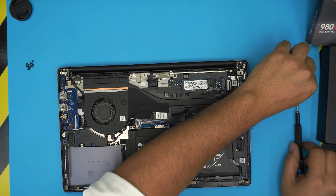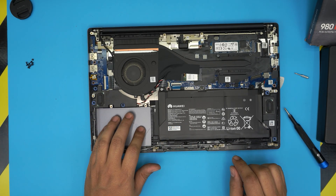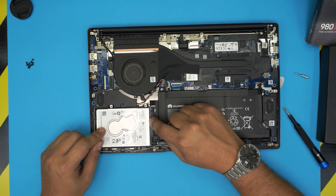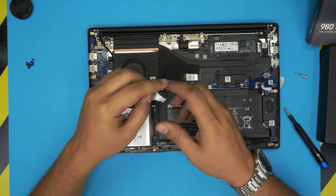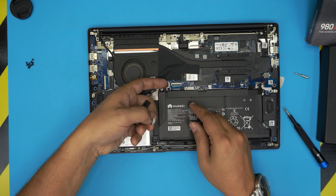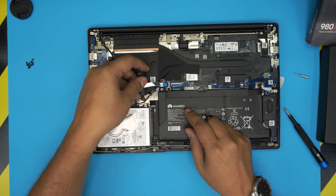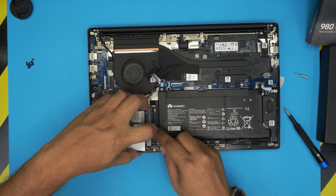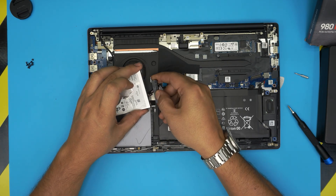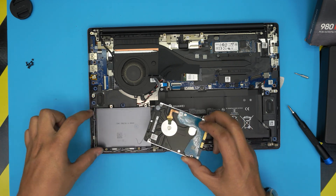Then screw the tiny screw right on top. Now the second option is to add a mechanical drive or another small SSD — a 2.5-inch SATA drive in here. These are low-profile hard drives. You can grab a mechanical drive, put it right over here, but you will need an adapter to go from the drive towards this jack. Those adapters can be purchased online — I'll leave the link. It should have a longer flex cable. Open the jack 90 degrees upward and the cable goes straight in and locks.